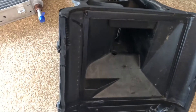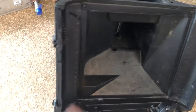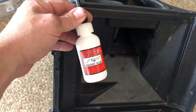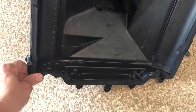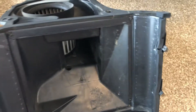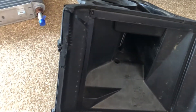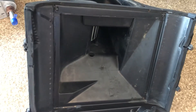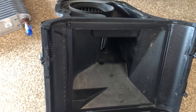So this stuff would not stick with the self-stick tape. What I did was I cut it in half and used a little bit of CA glue — which is basically just super glue — and I just glued it in place. It took me a while because I had to put a little glue there, hold it, keep it from moving, then put a little more glue, hold it, keep it from moving. But this is going to ensure I've got a nice airtight seal all the way around the edge, and we're not going to be sucking in engine air into the compartment.